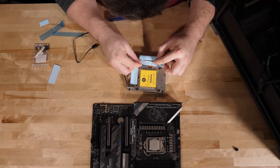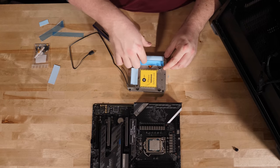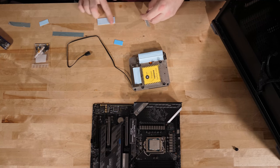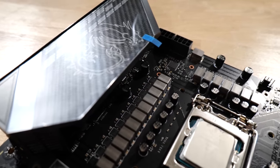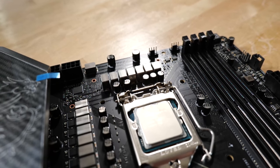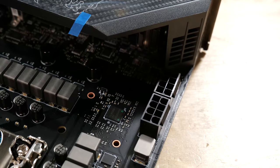For the water block installation, it's pretty straightforward with nice clean machine-cut lines. You've got your thermal pads that conduct heat away from both the chokes and the VRM assembly to the monoblock — that's what's meant by monoblock. It's cooling both the CPU and power delivery, because when the CPU is drawing 300 watts, assuming 5% loss through the VRM, that's 15 watts; at 10% it's 30 watts; at 15% it's 45 watts. It's a lot of heat generated on the motherboard.